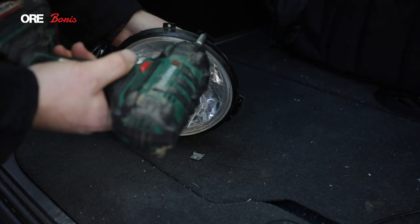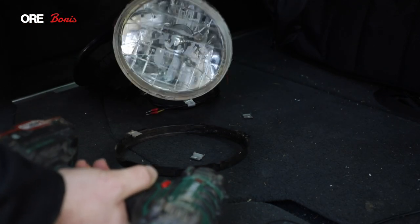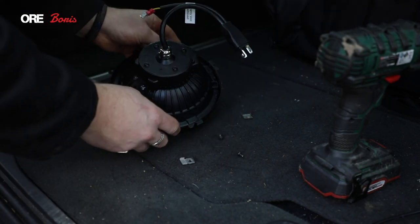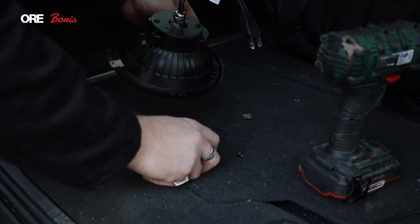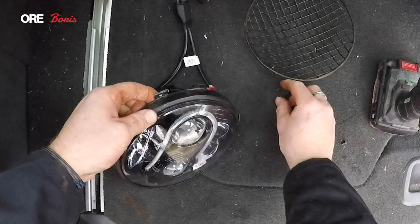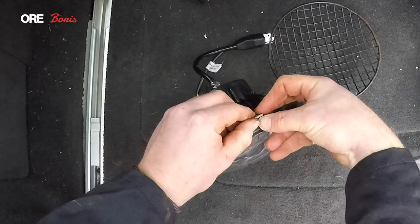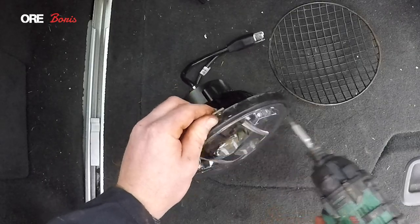Here's the old light with the light surround — I just pulled it off. What you do is just undo these little clips. On the top there's a tab and then the angled bit — that's a good way to remember. Undo those and it pops out. On the light there are these little metal tabs sticking out — you can see them raised — and they are what the clip actually rests on to hold it in place more securely. That's quite an easy way of making sure you've got the right orientation so it doesn't look wonky. Make sure it's all clicked in nicely all round.